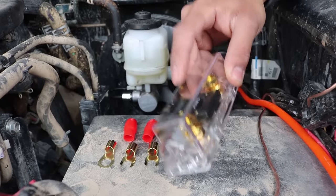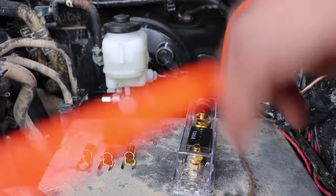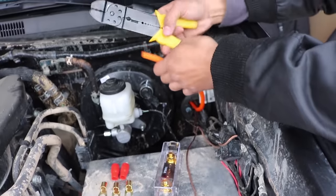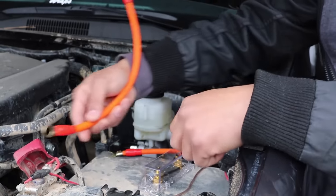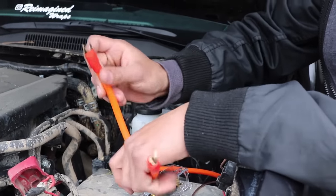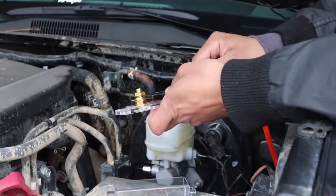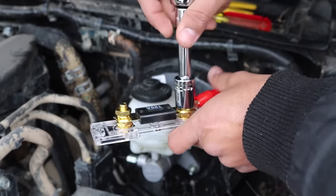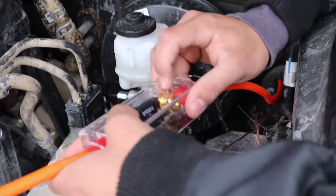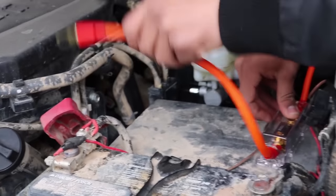Get your provided fuse box from the amplifier kit. I'm going to use two open tabs and one closed end tab. We're going to cut into this wire to install the fuse around this section. Strip your wires — basically you're going to get your wiring so the circled end connects to the positive of the battery, but do not do that until you install everything, so I'm going to leave that hanging. The open tab end goes into your fuse box. Slide them in, get a 14 millimeter socket and tighten it down — don't over-tighten or you could break it. Do the same for the opposite side. I'm going to use double-sided tape to mount it. This end goes to the positive of the battery, but we won't be doing that just yet.